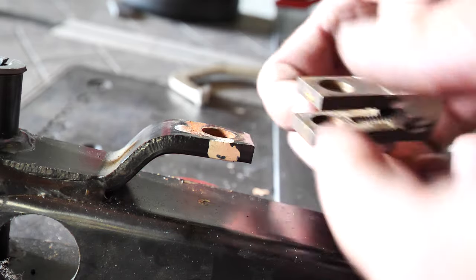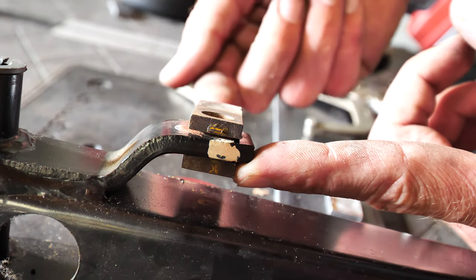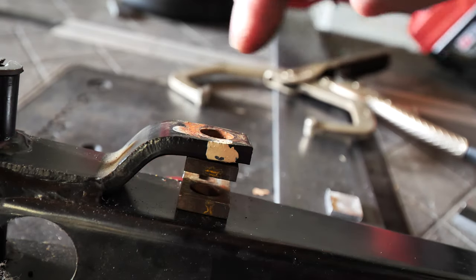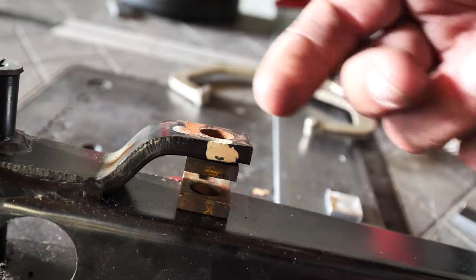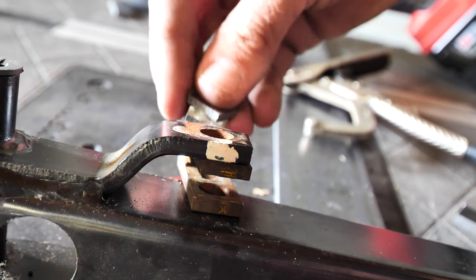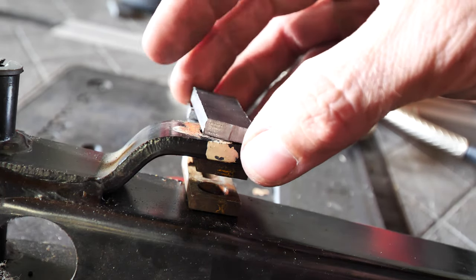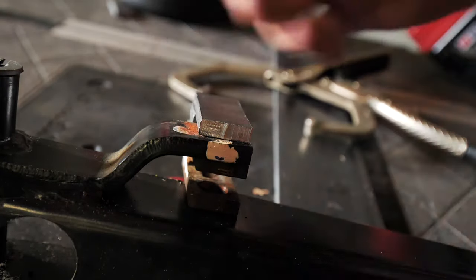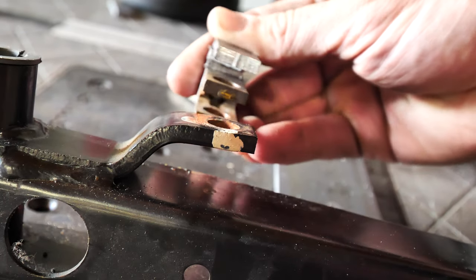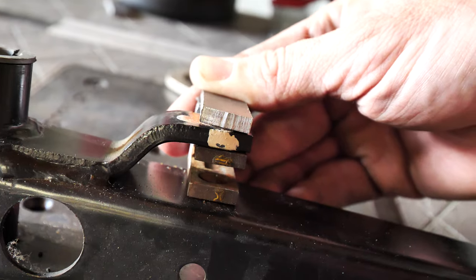What we have here is the original clevis - normally it's hooked up like this. Well, what happens is the brake booster gets moved over this way, so we have to make this fit over here. You could just hook it up with one pin through it and just have one side of that clevis working, but that's not really safe. What I'm going to do is stack these two little pieces to give me the gap, cut up that other piece of steel, and then weld this all together. You can see we've got this triple fork situation going on - I'm going to clamp that down and weld it up.